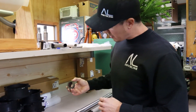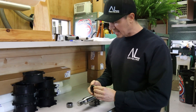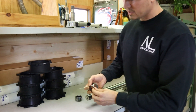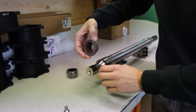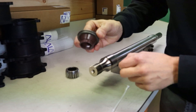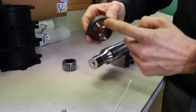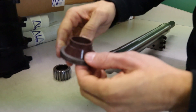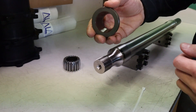The next area of the ball gear end of the shaft is this rubber boot. These things are very, very important and what guys do — they often make the mistake of cutting that zip tie when they do driveline service. I never suggest cutting that zip tie unless it's an absolute necessity for installing the swivel ball inside the coupler. A lot of times guys will get in there with their pliers and put a little tear in the seal, and that tear spreads and the seals end up flying apart. So leave the zip tie on there at all times if you're able to, and when you do maintenance, inspect these things. Make sure there's no tears, no cuts, because when they fly apart all the grease comes out of the coupler and you end up toasting a swivel ball.